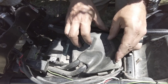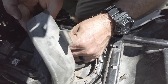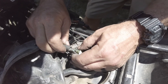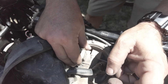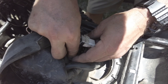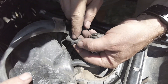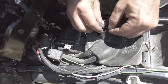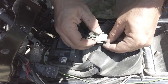The very last two on the very back part of the harness: be very careful with these. I've actually reinforced these because they are a common issue — these wires are so thin. They go to the fuel pump and also to the fuel low sensor. These wires are so thin that they're prone to being damaged. We've reinforced them, so be careful — make sure they come through this cover properly. These wires break, and that could be bad.